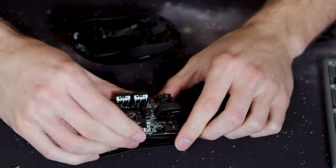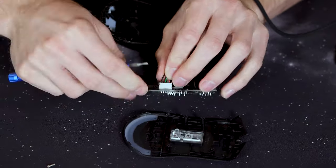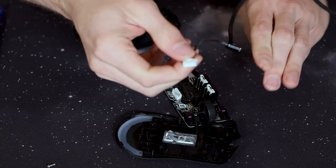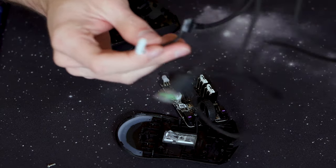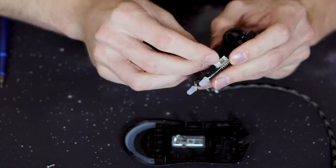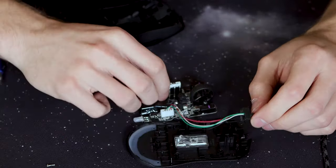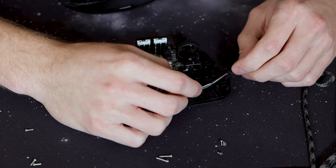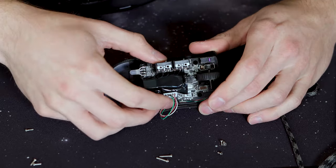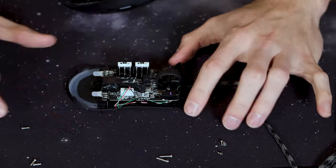Once you have the PCB off you can disconnect the cable, which has a couple little clips holding it in. I used the flat head side of a screwdriver to loosen that up and pop the cable out. Then pull the whole cable out of the mouse. Take your new paracord cable — whether from Lethal Gaming Gear or any paracord cable — and stick it in. The 3D printed stress relief makes it easy to fit into that spot instead of using a lighter and shrink tube. Just reroute the wires back through where they were before, making sure you don't close the shell on top of loose wires.